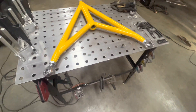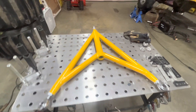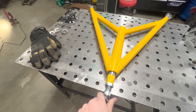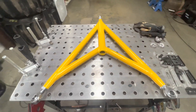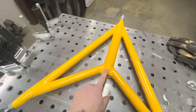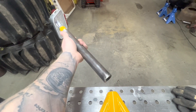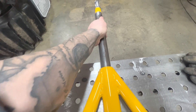These two links here are going to attach to the rear just underneath the axle, and then I have the crossmember in front where this will go, and as the suspension moves up and down this moves and hopefully that will help us out. I just built this out of some DOM. This center piece is just some pin stock. I double-walled this part here — you probably don't need to, but I'm good at breaking stuff so I'll build this part a little bit heavier.